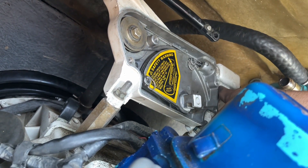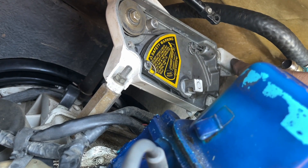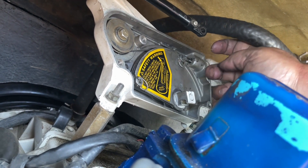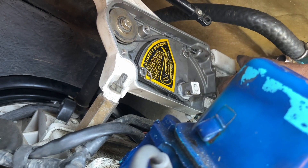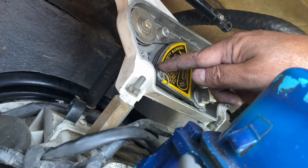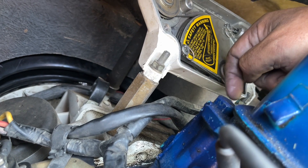I'm just going to put the cover back on. The cable itself is clocked back here - there's a flat side, literally almost at what I'd call about the three or four o'clock position as you come around to the back side. That way it puts the long cable at the top and the shorter cable at the bottom. You do the same thing here, and there are two grooves on top of the pizza wedge. It's easier going on than it was coming off.